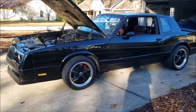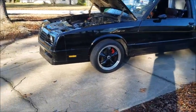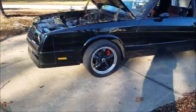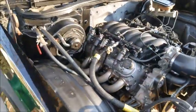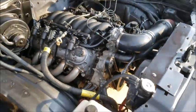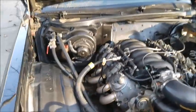I had my SS out so I figured I'd take a video of how I built this car since I've changed a few parts around. Started off as a 305, 200-4R, 7.5 rear car and that didn't last long. What's in it now is a 6.0 liter LQ4 out of a 2006 van - it's got 243 heads, LS6 intake, Thunder Racing 230/236 camshaft, so it makes pretty good power. Heat-only car, not real concerned with air conditioning.